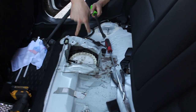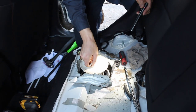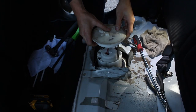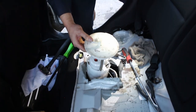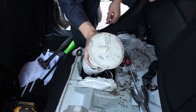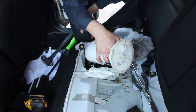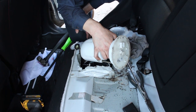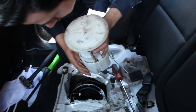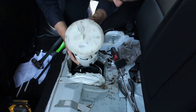There are two springs on the side inside, so it might spring up once it's loose. There's a fuel level sensor we have to watch out for. Ideally you want the tank to be empty. Tilt it slightly while the fuel sensor is still in there and let fuel dump back into the tank. The float is kind of big and gets caught on the rim. There's our 94 octane — it's going to be a little messy but it's all in the name of boost.